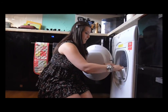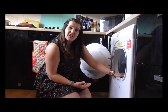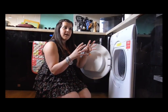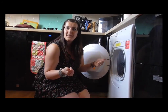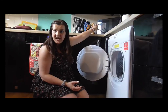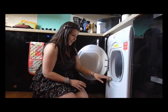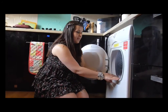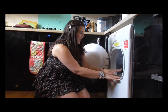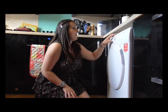Now I have a nice clean filter that just slots into place at the front. Because it's vented, I've got this plumbed in — the hose is going out of the back of the machine and out of the house. This is different from a condenser tumble dryer. You've always got to make sure the filter is pushed into place. My load is in there — shut the door.